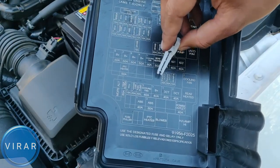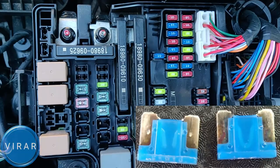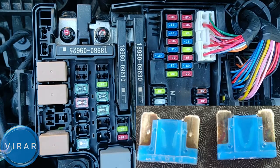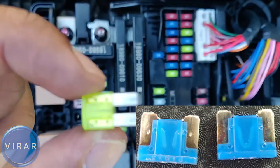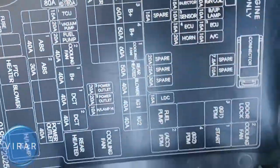Let's check out the fuse for the driver's side outlet. The power went out in the power adapter. Once you get the fuse out, compare it against the picture on the bottom right corner. If the metal strip in the middle is broken, then it's a bad fuse. If the metal strip is not broken, then it's a good fuse and the problem is something else.